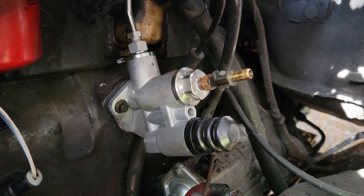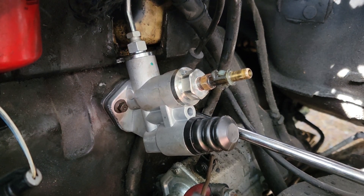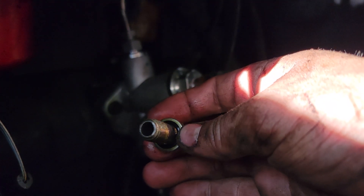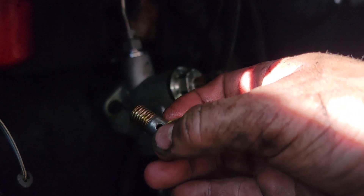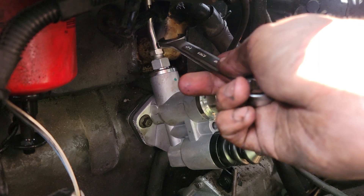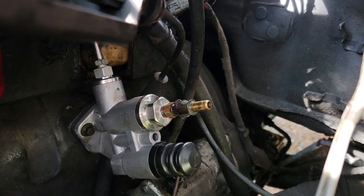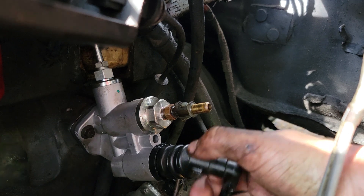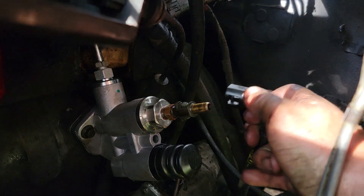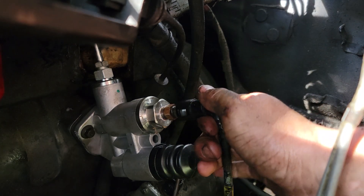The bolts that go into the block for the fuel pump are tightened to 18 foot pounds or 216 inch pounds. I'm going to use my inch-pound torque wrench and come in through the fender well. I'll get my banjo bolt started with new O-ring washers — put one on, go through the top of the line, put the other washer on, and then into the block. Tighten the fuel line at the fuel pump end, just snug it down. Then put the quick connect back onto the fitting you transferred over — just make sure that plastic is lined up.